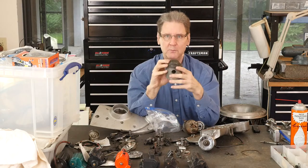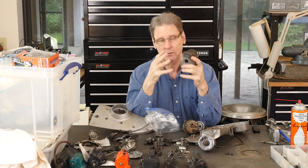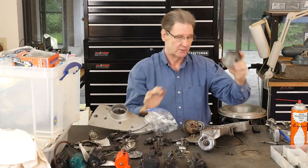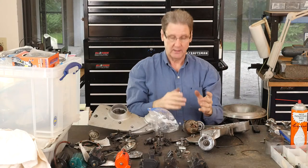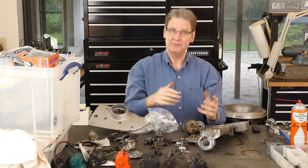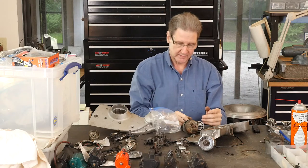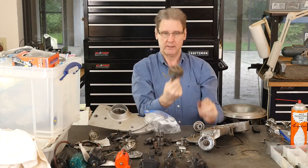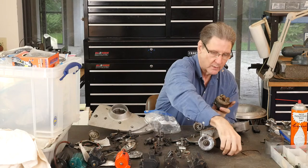The other problem with doing it this way is the surface area of the top of the piston is immense, so all kinds of heat goes into the piston. It runs hotter, so it's got to be clearance looser and all these other issues. Because of this big advance requirement, since you need so much advance, if you went to kick start with 45 degrees of advance, you'd never get it to go over top dead center.